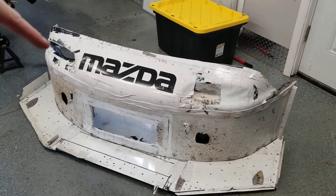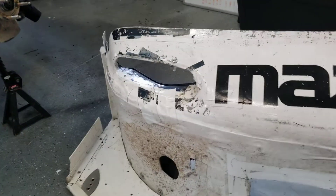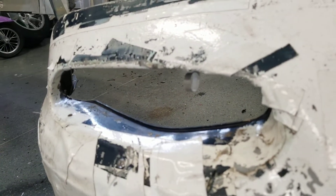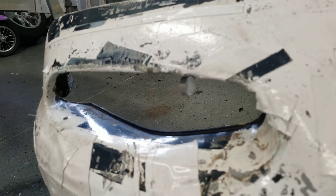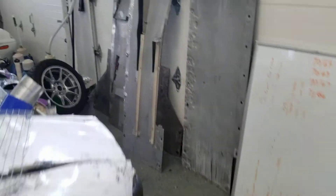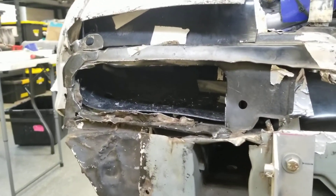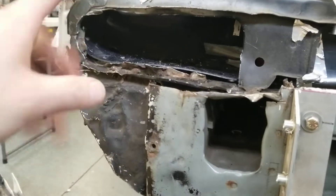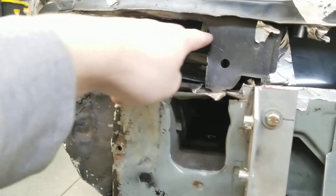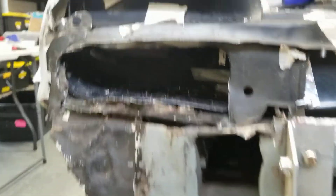Over on this side, that's the intake side — the first aero element I want to talk about. You can see we actually trimmed out a lot of extra flange that was there. We cut all that out because we wanted to make it as smooth and as big as possible. That feature goes into the air box here. We cut this all out — it's all mangled because of various contacts. This car has been a race car for a very long time. We cut out some pieces here and wanted to make this flat and streamlined so all the air could go into the air box.